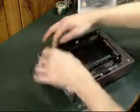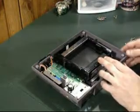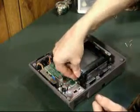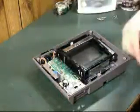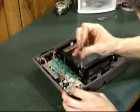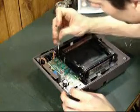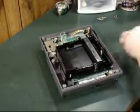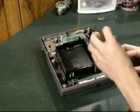If you do have trouble, you can just move your wires around until your board sits properly. Now that we've got our board in and it's all setting down nicely, we are going to attach the game port. If you'll remember, this is where we had the two gold and one silver screw. The silver screw goes into the middle hole, and your two gold screws go on the two outside holes. Screw them down and if everything's lined up right, all your holes should line up and you should be able to screw everything right back down without any problem.